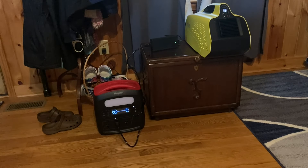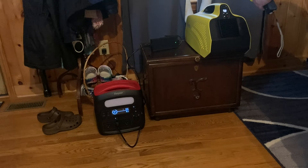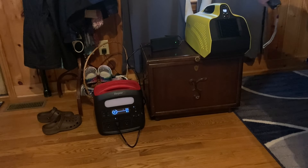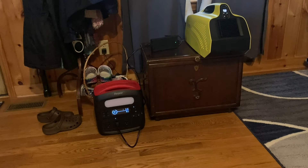So although this thing will pretty much run all night, then as soon as the sun comes back up and hits those solar panels and starts charging again, you could probably continuously run this thing camping if you have a good area of sunlight. Because if it's using 100 watts and you have a 200-watt panel, it'll take a good while to charge that up. I'll do a little temp check here — 61, 60, 59 degrees blowing out. That's some cool air. That would definitely feel good blowing on you after coming into the camper, sweating outside and getting ready to go to sleep.